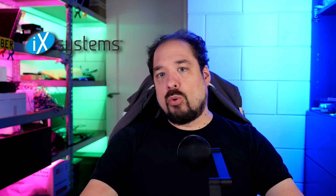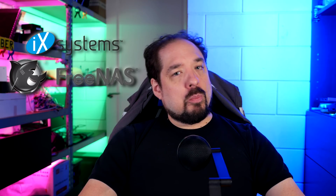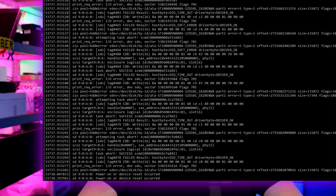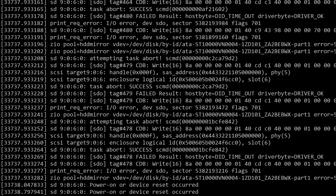So I started digging into this, especially using the iXSystems forum, which is the FreeNAS forum basically. There were more reports of people using IronWolf drives who were having these issues, but it was very intermittent. Some people were using them and everything was fine — like I used to be — and some other people couldn't use them without errors. Looking at ZFS, I mainly saw ZFS delay messages in ZFS or Zpool events. Basically, the controller at some point would try to write to the drive, it would stop responding until the controller reset the drive, and then everything was fine again. ZFS would report an error, but after that it could read the data and repair it just fine. So I knew these drives were okay — I was 100% certain because I tested them all extensively.